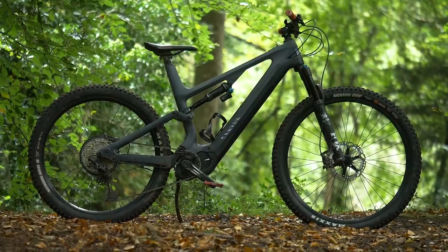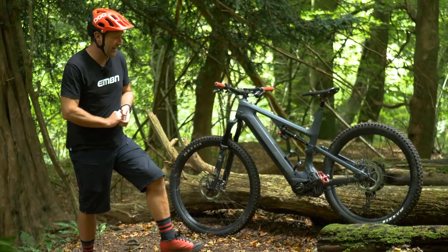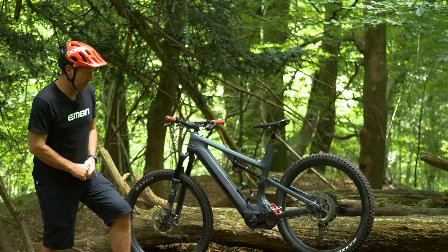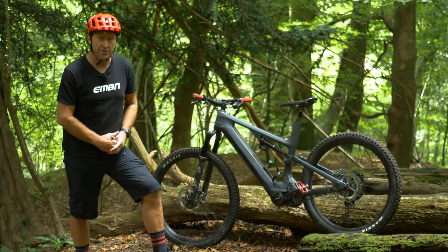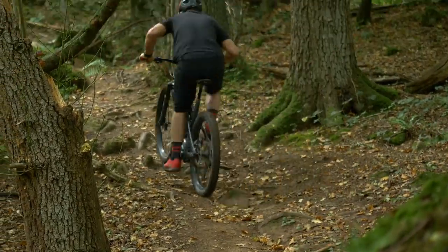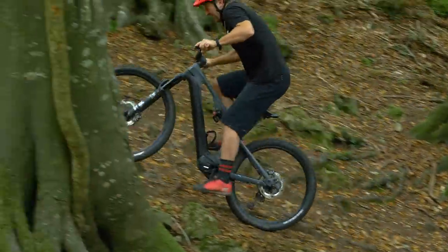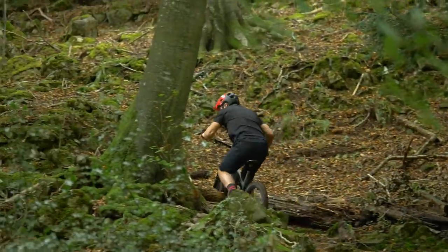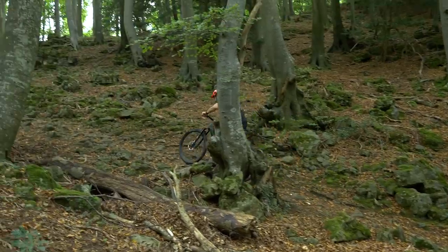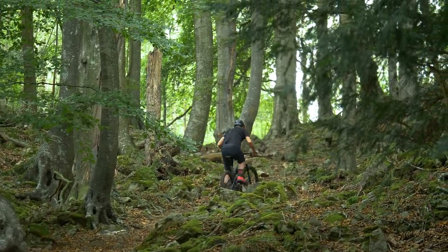The Canyon Spectral On with the Shimano E8000 motor: 29-inch wheel up front, 27.5 on the rear, 150mm travel front and rear. The all-important component in this uphill challenge is the 2.8 Maxxis DHR2 tire, at about 28 PSI to get the grip on that limestone rock. It's important to keep the cadence high on the E8000, as at lower cadences you can struggle on the steeper stuff. Despite the limited maximum power, boost mode can be a handful and you still need to anticipate the terrain. At just under 23 kilos, the Canyon Spectral is a light bike. With a reach of 485 millimeters, there's plenty of room to move around the bike to get traction front and rear. The shorter chainstays, which make the bike so good at cornering, also means you need to be mindful of your body position when climbing.